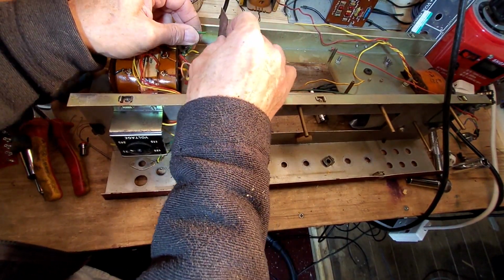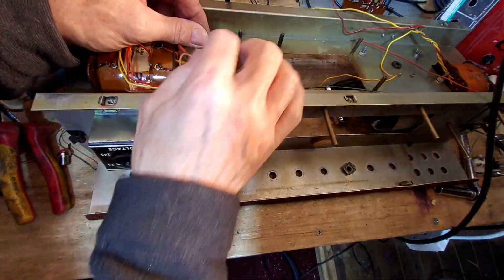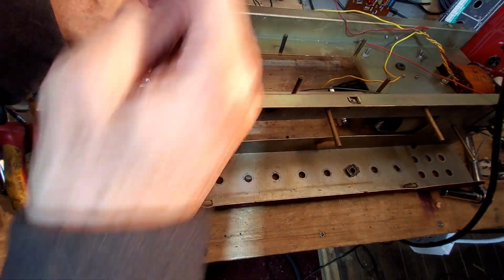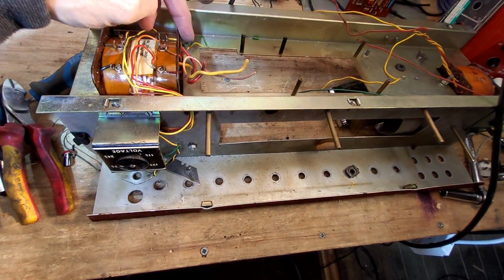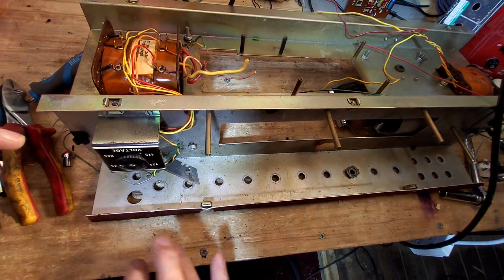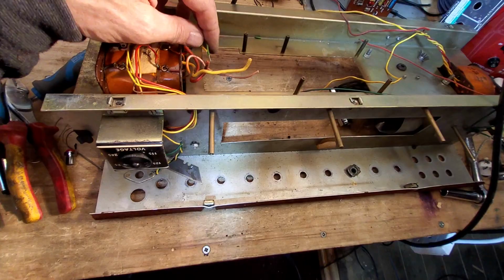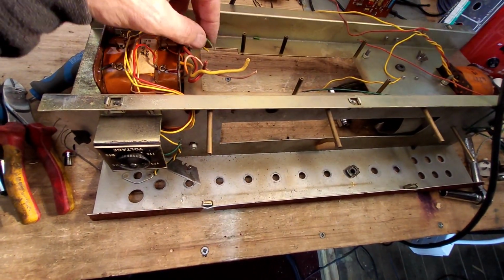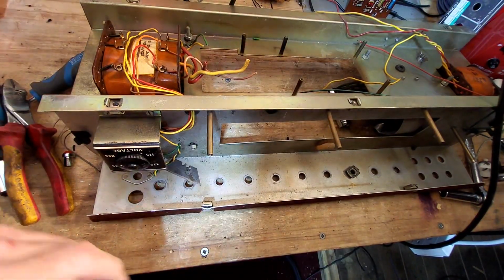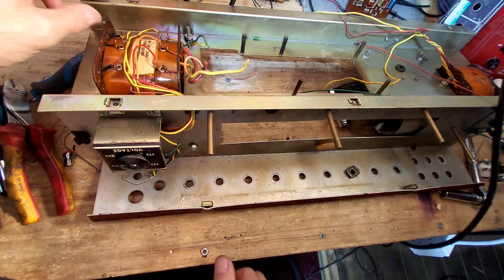This wire is rather stiff due to being old, the heat, and so if we look now, I've cut around that with a knife, and I just pull it away. You can see like that. So we never pull on these transformer wires ever, because if you pull one out, it's all over, and that's a very expensive mistake to make. So if you're going to be cutting these, use a Stanley knife blade, cut around them like I've just done, and then hold that, it just pulls away dead easy. There you are, tip of the week there. What do I know?